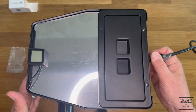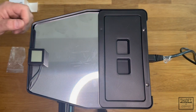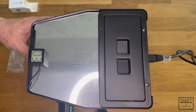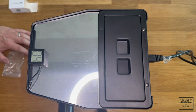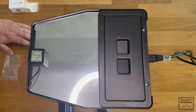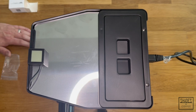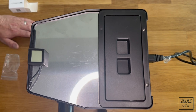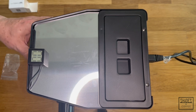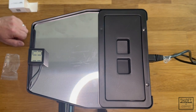We'll briefly turn the machine on and hit the brew switch just once to watch it start up. The machine has absolutely no water in it, so it won't do a huge amount, but you can see the ChronoCube running and counting. It's a very noisy machine with no water — the pump is running dry. Within a few seconds the ChronoCube display will turn off again. Once it's turned off it's drawing very little power, waiting for your next shot. There's no power switch — you don't have to touch it. It's completely autonomous. When you brew your next shot, hit brew, and it will start counting again, automatically stopping whenever you stop the pump, displaying that finish time for around 20 seconds before turning off.